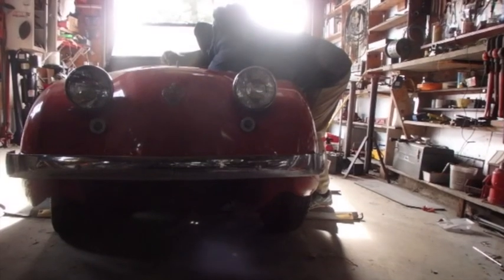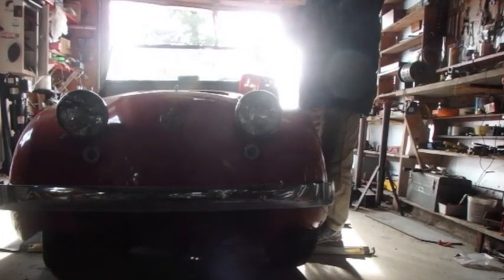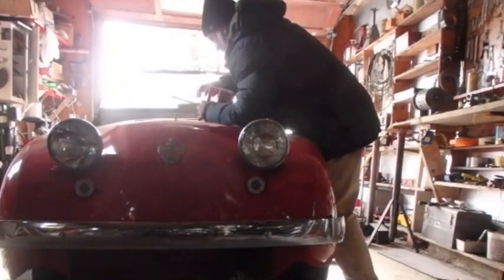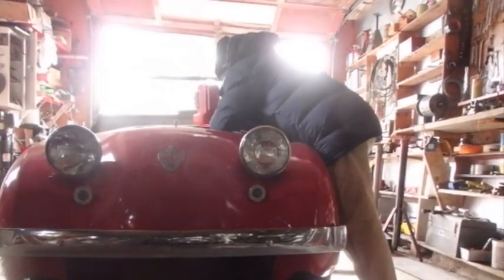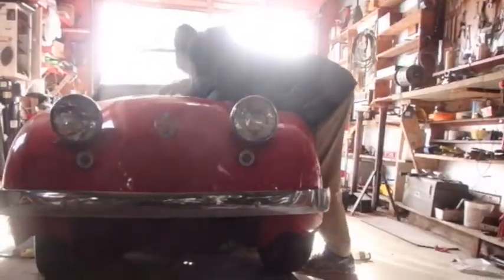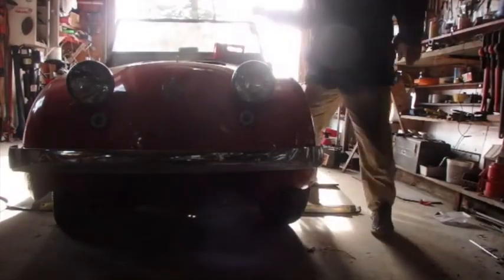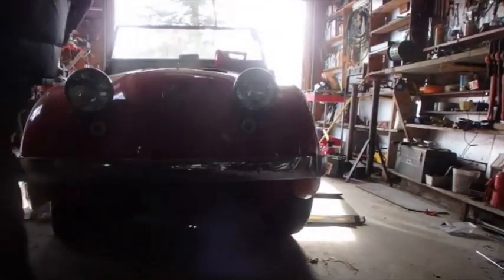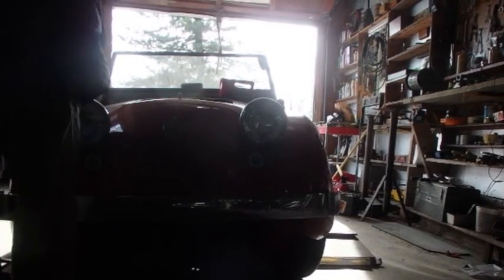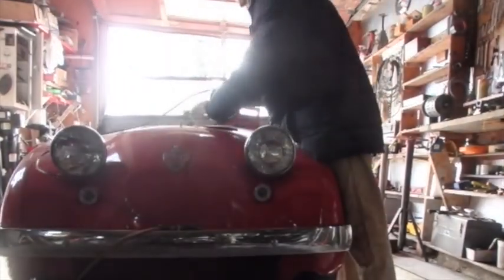See, that gear is moving, but it's not even touching. The bendix is moving in and out, back and forward like it's supposed to, and spinning — but not even catching the flywheel, just like I was saying. I'm wondering now, if I pull the motor out and mess with that flywheel, whether that would actually fix it. That starter is coming forward, but not enough — not too much.